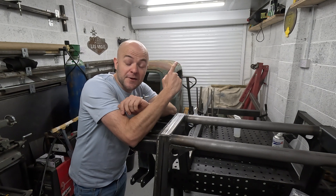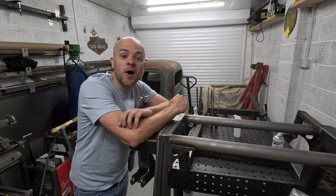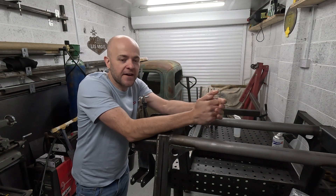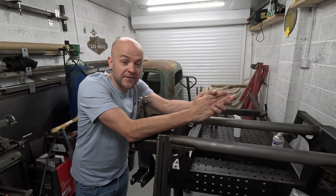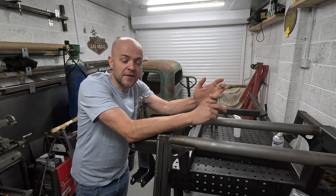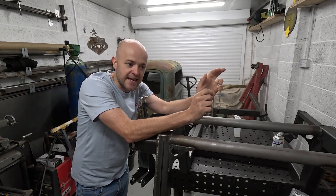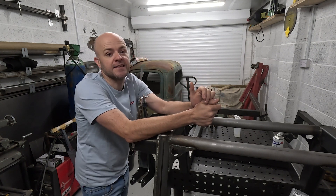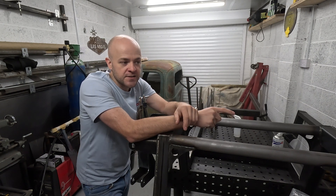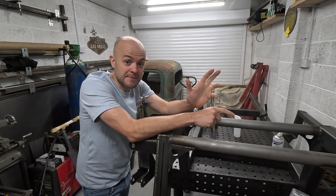Before we go and have a quick look at the car, I'm going to cover what did and didn't work — and the list of what didn't work is quite a bit longer. I did the standalone loom and then looked at making a trigger wheel because I was having issues with the power steering working and the ignition. The Audi A1 has a weird behaviour where if it doesn't sense it cranking, it will cut the ignition quickly. That was one thing I needed to address with a push-to-start button.